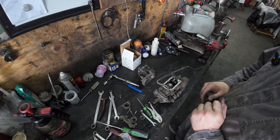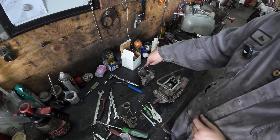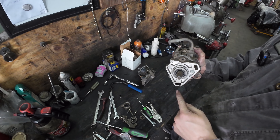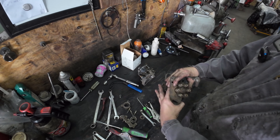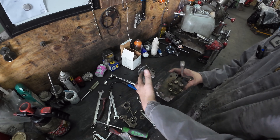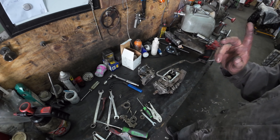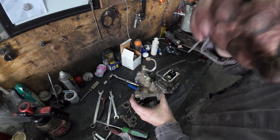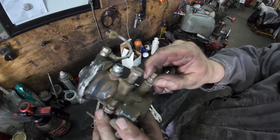When doing the timing, you want those tools plus regular tools. I also use a dead blow to tap the pump up - just tap it right here, don't beat on it too hard. You need to loosen these three bolts - this one's actually missing a chunk, don't do that. You need to loosen those three 13mm bolts and there's also a 10mm support bolt on the back that you need to loosen. Use a line wrench for those so everything will pivot a bit easier.